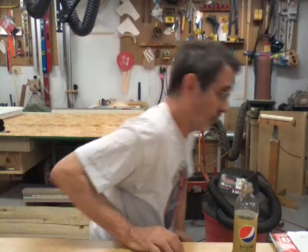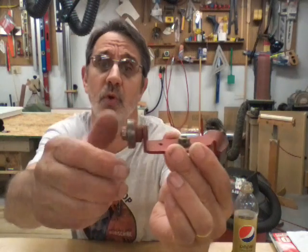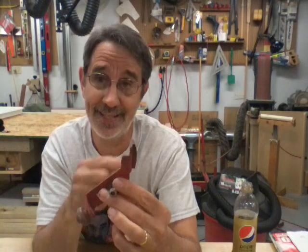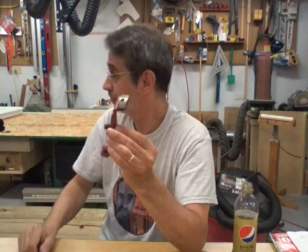They removed the brake arm, cable, everything except the pedal. Now I have an old arm over here for a closer-up view. That's your brake shoe. This is a roller that the yoke pushes up on and applies the brake on the inside of the clutch assembly. You've got a quarter-28 bolt, a self-locking nut, a washer, and a little tube that acts as a shoulder bolt so you can't over-tighten it and lock it up. Those are the parts you're going to need, along with a brake cable.